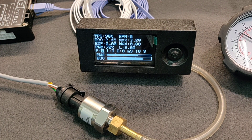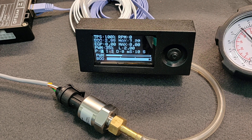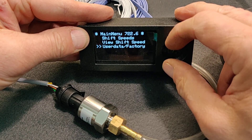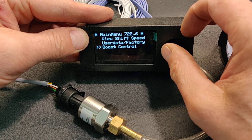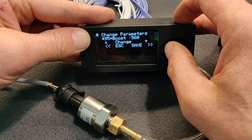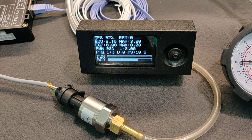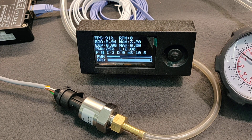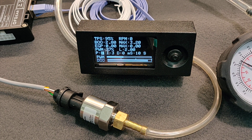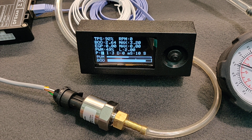We go back again and try to raise the pressure to three bar — now it's very close, maybe a little under. So we go down to boost menu general — boost max boost at five volt — and I put it up to 5.6 bar at five volt. Now it shows absolutely correct. This is how we set up the boost sensor to make it match the zero point and the three bar. That's it, bye.